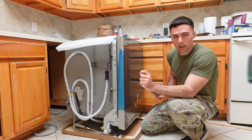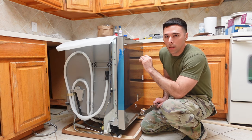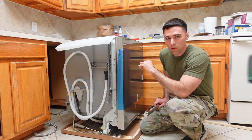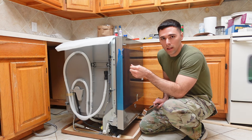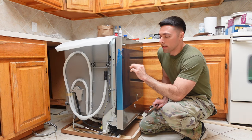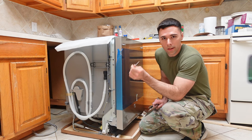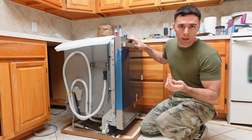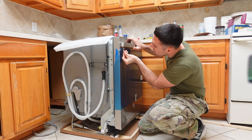Step one is to install the dishwasher handle, but before we do that there is some prep work. If you're going to install your dishwasher, make sure you've already prepped your water line and your electrical line. If you're going to plug into an outlet, there's nothing really to prep. In this case I'm not plugging into an outlet — I'm going to leave it hardwired. The water line I bought separately — a five-foot line — already run and attached to my valve underneath the sink. The last thing you want is to get this thing three-quarters of the way into the cabinet and realize you can't reach your water line. For the handle, just use the allen key that comes with it, put the handle on screw-side down, and tighten them up.